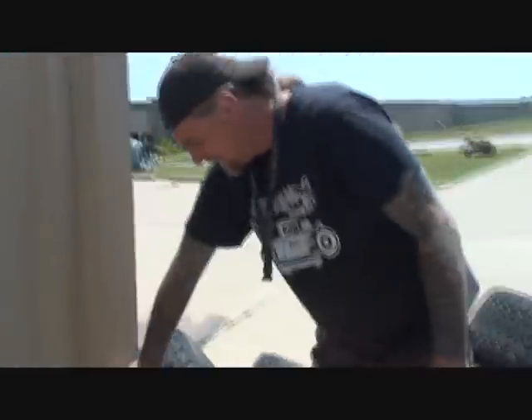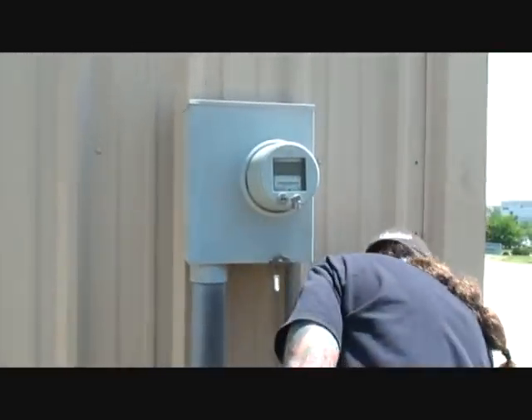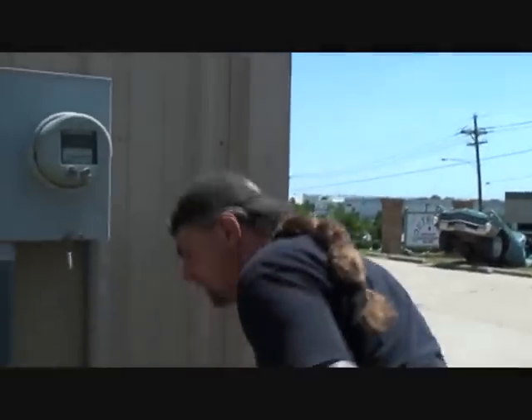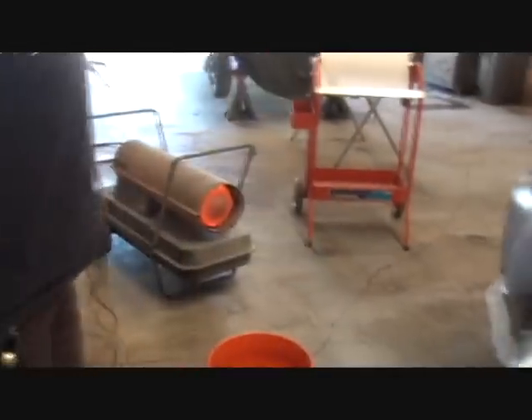Check it out when it's all primed. I'll show you the situation we have, and in a week or so when she brings it back, we'll show you how to paint it. I went ahead and primed it, but I don't think the lady that owns the car is going to understand what the hell's going on when she sees her car looking rough. So what I'm doing in there, I'm force drying it. I'm going to go ahead and wet sand with 400 and then put one more coat of primer on, and it'll look like brand new.